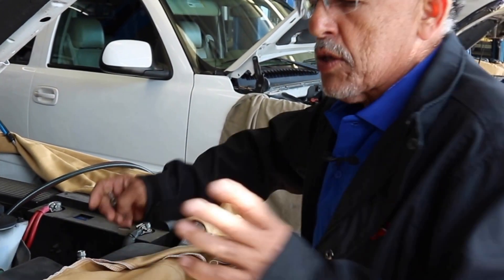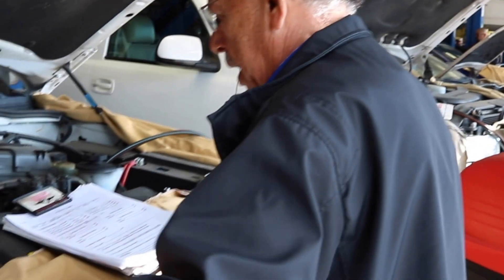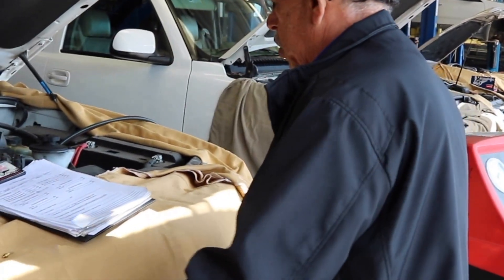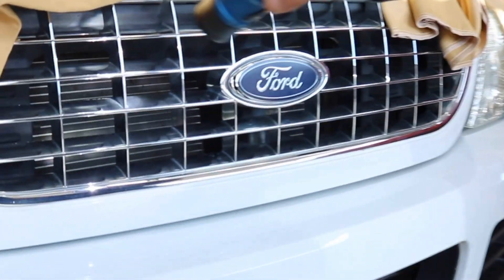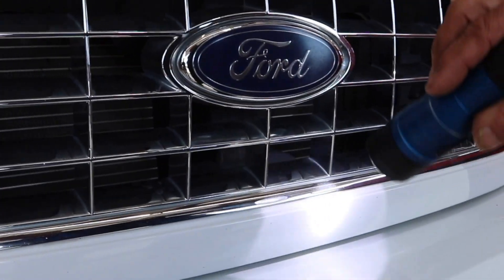One of the things I want you to do at home is a visual on the car. What I mean by a visual is you look at the condenser. On the condenser — hard to see on this vehicle, but right there — you look for oil spots. Look real carefully with a flashlight. If you see an oil spot, you probably have a leak.